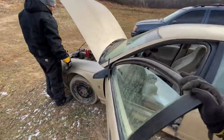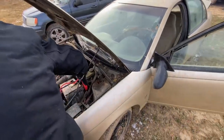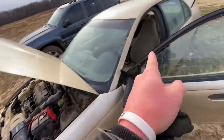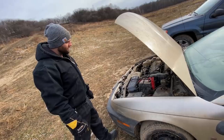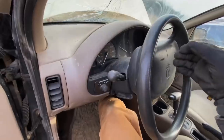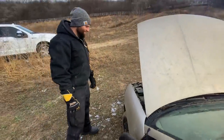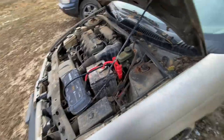She's definitely been sitting down here for a long time. I might have to do what we did last time — put the NOCO in the back seat and run some booster cables all the way up, because the alternator must be out of this thing if she's not charging. Alright, let's fire it up once more and let her idle for a bit. We'll let her warm up for a few minutes and figure it out. Close the hood.